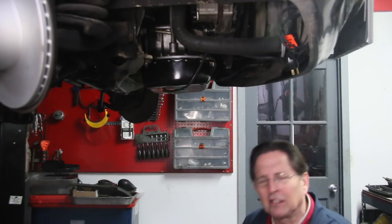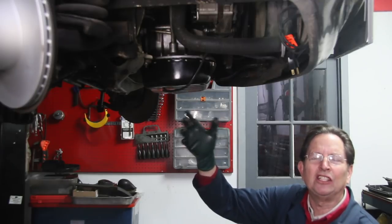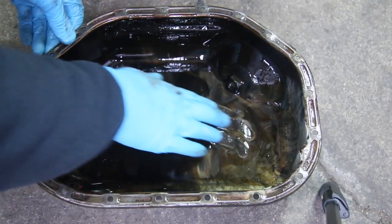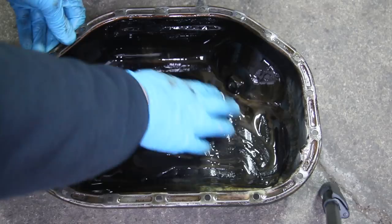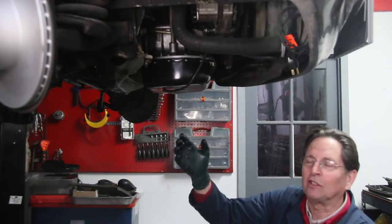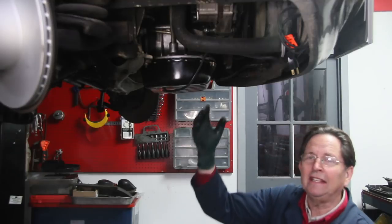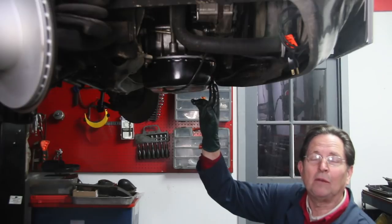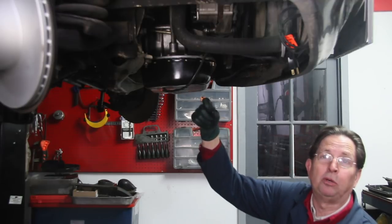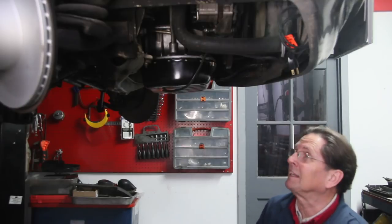But the third reason you may not have thought about much: these pans get really filthy with old sludge and emulsified engine oil. Look here when I removed the pan — look at what was in the bottom. That's not going to come out with an oil extractor, and it's certainly not going to come out by draining the pan. You would see that and get really concerned and say there's water getting into my oil. Stop and think a little bit — you need to know the history of the car. The car had been parked a lot, it's in a high moisture environment, gets started up but doesn't get driven a lot, so there's a lot of moisture in the engine that doesn't get cleaned out during long driving periods. That didn't concern me because I knew the history — it sat for quite a long time without being run. So if you get a car that hasn't been driven a lot, hasn't been a daily driver, or maybe had infrequent oil changes, I would pull the pan to clean it out, because it's the only way you're going to get it clean. And from what was inside the pan, that was probably a very good idea.